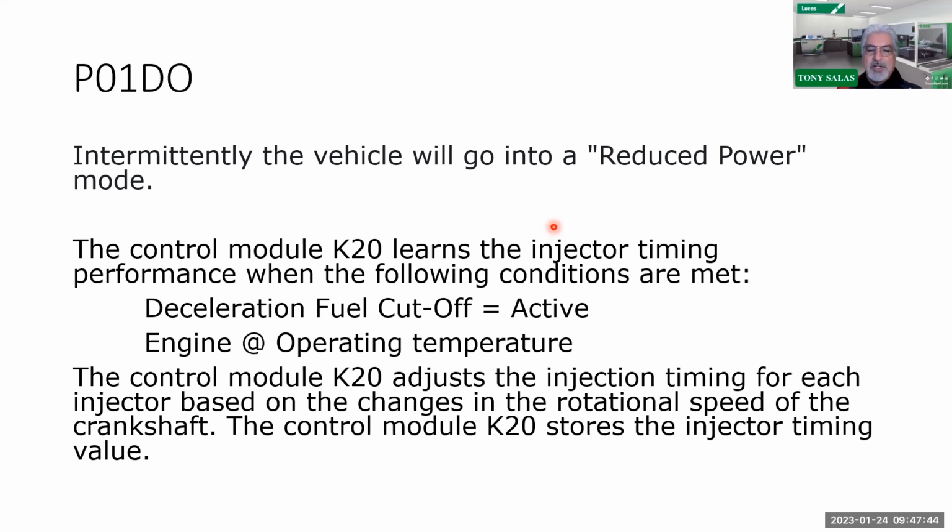And guys, are we going to be in trouble if we're running some kind of fresh air intake? You know, the big problem here. So therefore, definitely want to pay attention to that too. Is that air clean, and is that mass airflow damaged or sandblasted? Here in lovely Las Vegas, where I'm in the desert, we have seen sandblasted because our number one problem here is dust in the air. We're getting high winds here for the last 2 days, 3 days. And in this case, it isn't surprising that we see a lot of dust on those intake tubes because of poor filtration. So there you go.